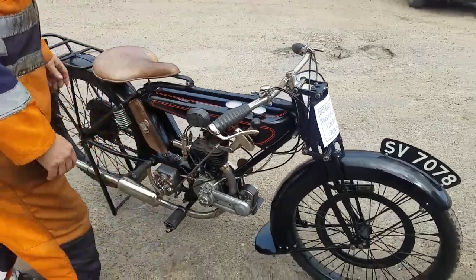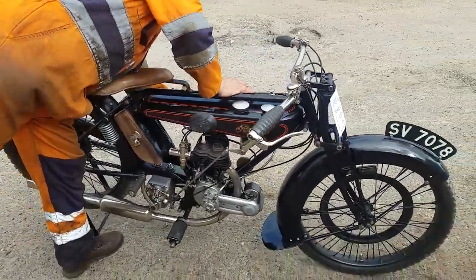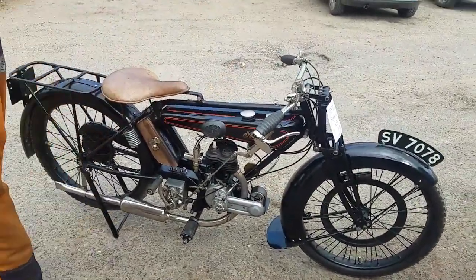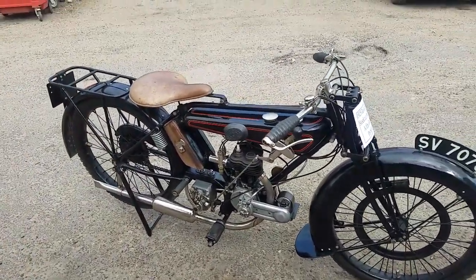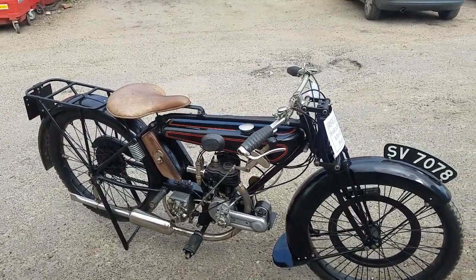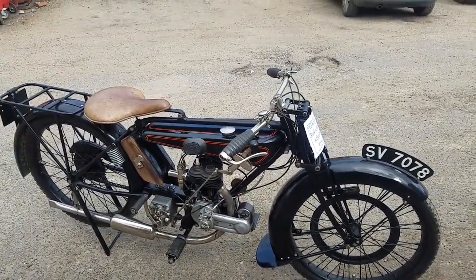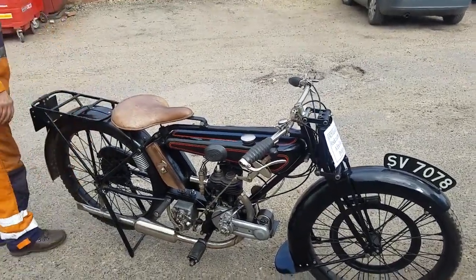Certainly a nice little motorbike, Pete. What do you think? It would probably benefit, if you're going to use it much, from having the mag rebuilt, I reckon. A lot of these things. I'm a great believer in having mags rebuilt, and my own personal B33 is the same. You don't know when it was last done. And even when it was done 10 years ago...